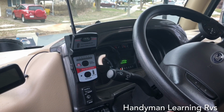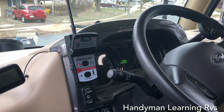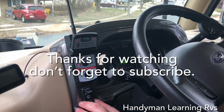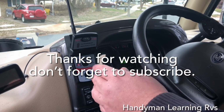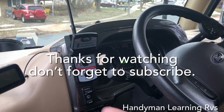Okay, with everything buttoned up, the wiper control switch has been remounted to this location to give you better access, instead of having to reach all the way down here and try to find it. It has been modified with 3 wires coming out to attach to the multifunction switch wiper control area to give me wiper control functions like a wired remote to this module switch. And now we're going to see how it works.